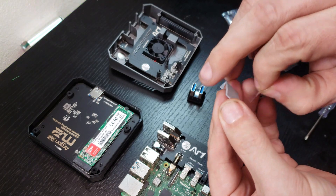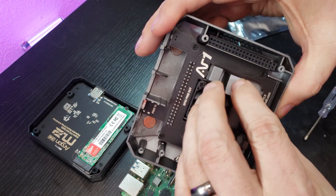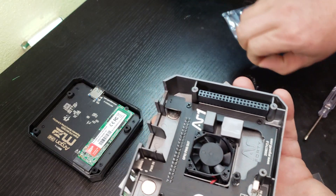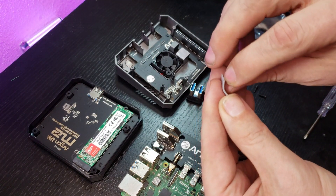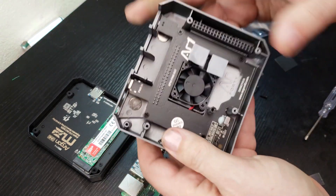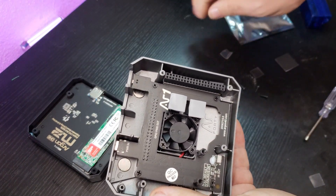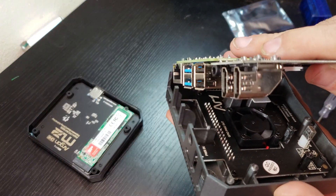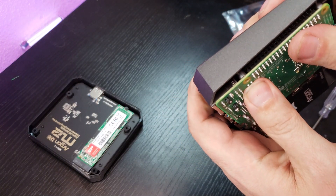A couple of the accessories we're going to want are the thermal pads they've included. If you end up not having these or need to swap something out, you could use thermal paste, but they've included thermal pads, so that's what I'm going to use. These go on the aluminum plates built into the case — they make full contact with the GPU and CPU and do a really good job of transmitting heat. There is also a little 20 or 30 millimeter fan moving air inside the case, which plugs directly into the GPIO pins. Software is available to control the fan curve, allowing it to always be on or to adjust fan speed based on temperature.